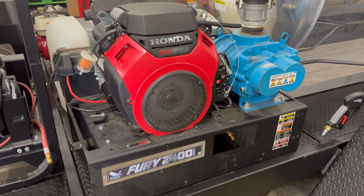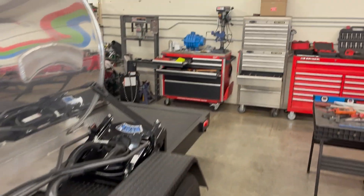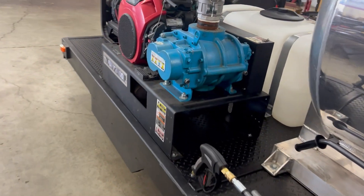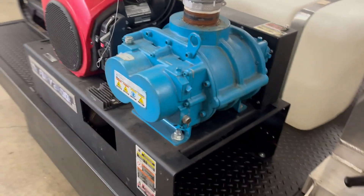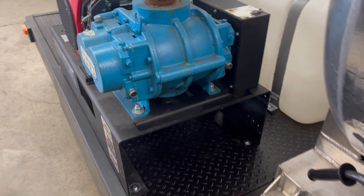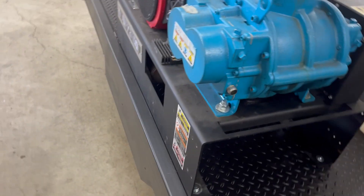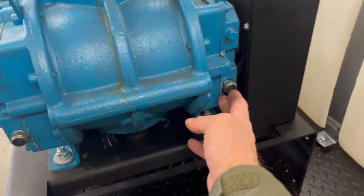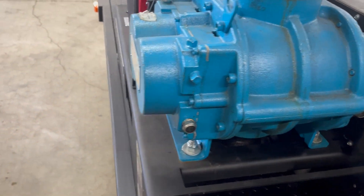It's powered by a Fury 2400 CVU. This 2400 CVU is a little different from the ones we normally run — that one is a five-inch blower that moves about 330 CFM. This is a 600 CFM trilobal blower. What's cool is it moves almost twice the air, and it doesn't have greaseable bearings on the back. It's wet on both ends — a blower case, a wet gear end, and the bearing end where the pulley is is also wet. So no more greasing bearings and having grease drip down — just an oil bath, a little less maintenance.